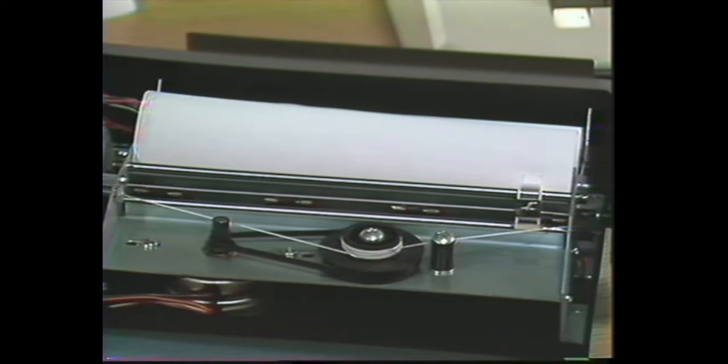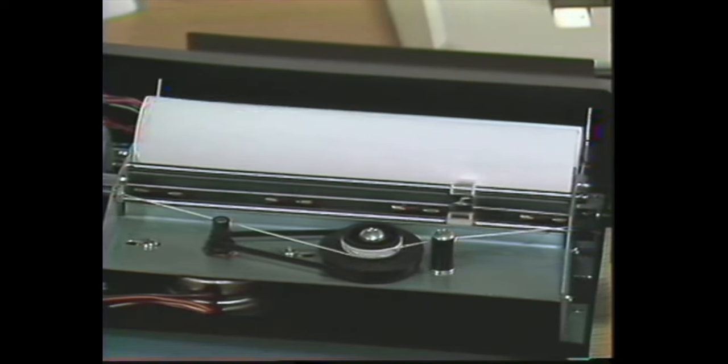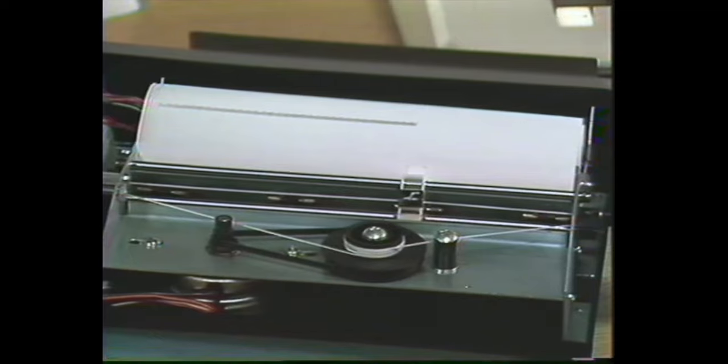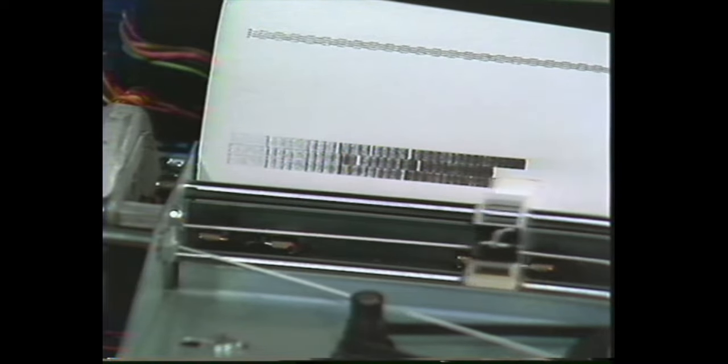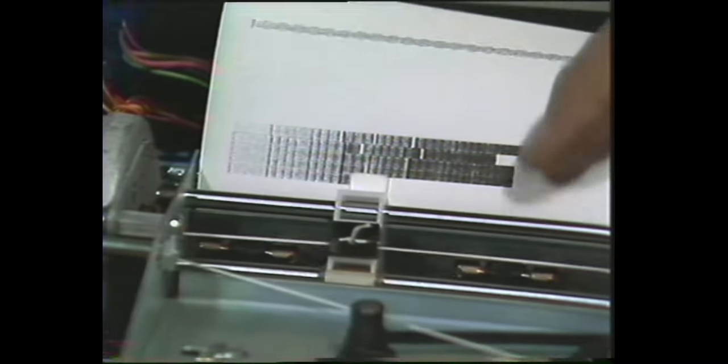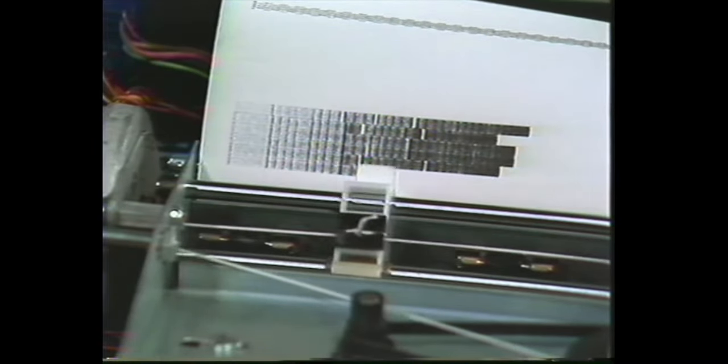In this case, yes, it looks okay. Now it's going to show us what the dot integrity is like. We'll look for the pattern indicated and look at the screen for any directions. That looks all right to us, so we'll respond yes. Next, we look at the print intensity test. On this test, you should be able to see eight distinct shades of intensity being printed out. This test prints about three, four, maybe five lines. If that is acceptable and we can see eight distinct shades of intensity, we press yes once again on the keyboard.